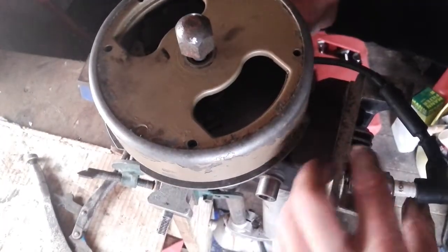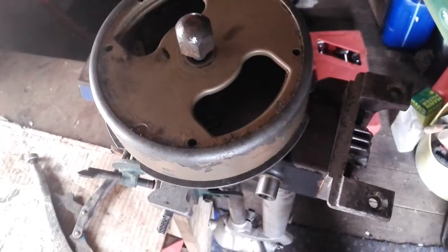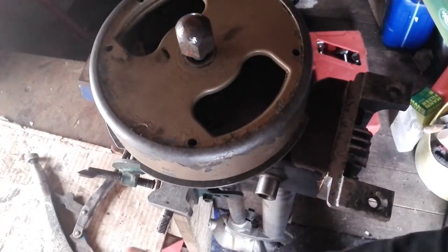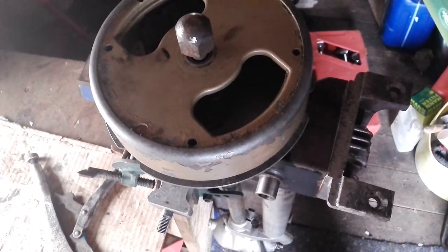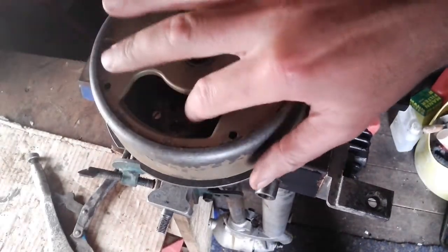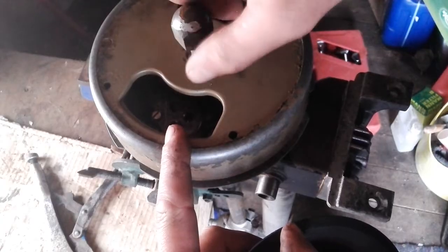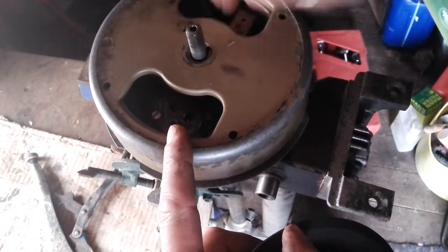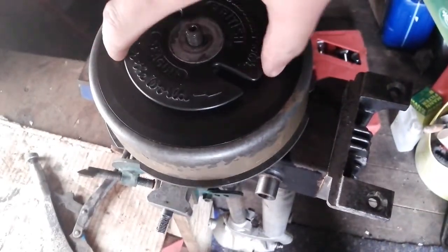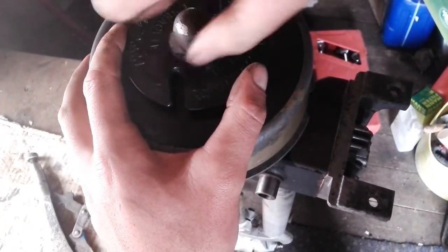That is more or less it — spin it up for 5 minutes, reattach your lead, make sure everything is clean, your points are adjusted correctly, and your plug gap as well. You can use a 20 thou feeler gauge for the plug gap and you should get your spark. You could put WD-40 on the points just to see the spark going across, then reassemble and you should be good to go. Particularly with the Villiers, they do need a spin-up, and your coil could actually be dead so you might have to check that.